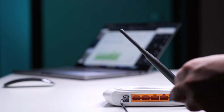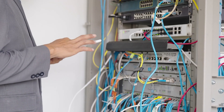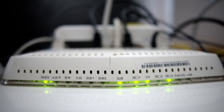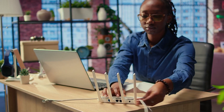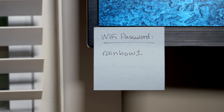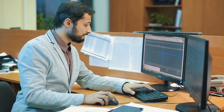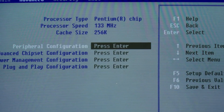Now that you've seen inside one, here are some practical takeaways. Check your router's firmware — outdated firmware equals security risk. Placement matters: central in the home, elevated, few obstructions, away from metal and large electronics. Consider wired connections for bandwidth-heavy devices like gaming and streaming to ease the load on wireless. If you have many devices, invest in a router with a strong CPU, multiple antennas, and the latest Wi-Fi standard, Wi-Fi 6 or 6E. Check for congested Wi-Fi channels and avoid interference from neighboring networks and microwave ovens.